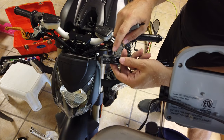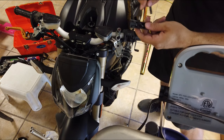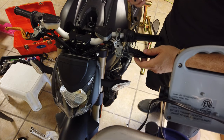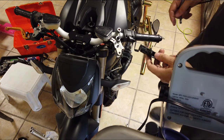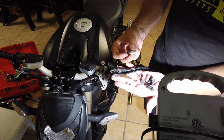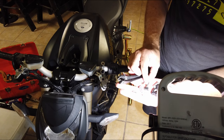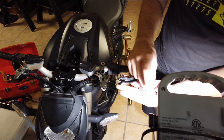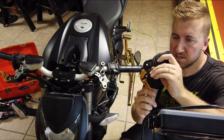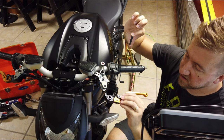There's a little silver pin sticking out that I never noticed before — there's a little switch, a little solenoid, and I'm betting this is telling the engine something about whether the clutch is in; whether it changes the way the engine runs or turns something on. The new lever has that accounted for, so we're in good shape. Here are all the same parts: the pin I used to pop out the steel cylinder, the steel pivot head, and the clutch piece which we're going to keep, clean off, and grease. And this is the little pivot arm and spring for keeping tension on it. I've cleaned and greased the little pin that goes in the new lever, and also cleaned and greased the new pivot pin for the lever.